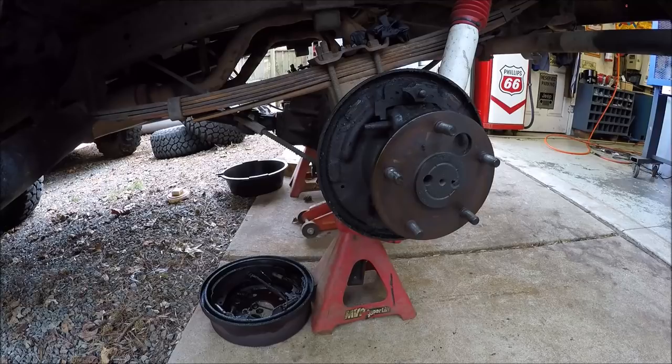Well guys, taking a break from trying to drill that broken bolt out of the head there. It's not wanting to come out with the left-hand drill bit. I about got her drilled through with a center drill and a regular drill, but we'll probably just drill the whole thing out and put in a Helicoil or an easy out and fix it.